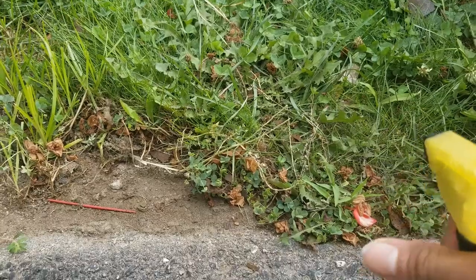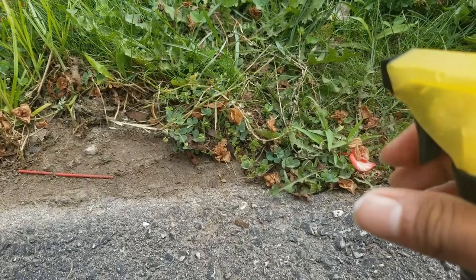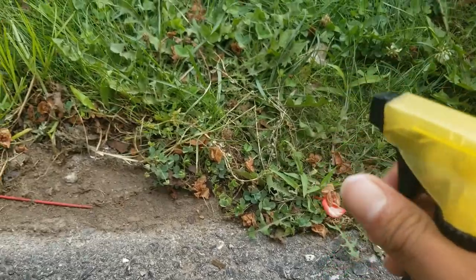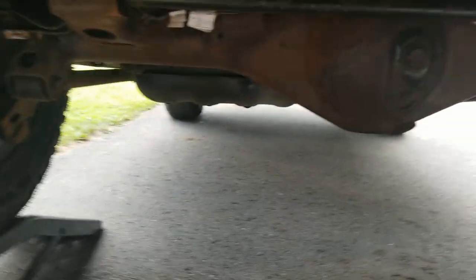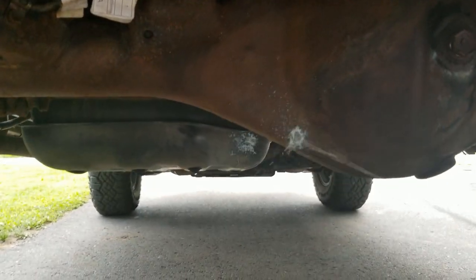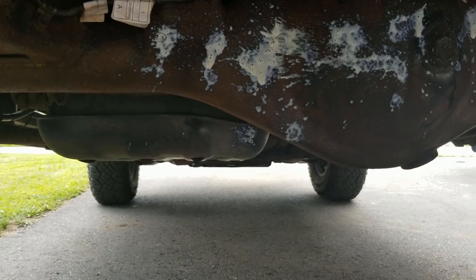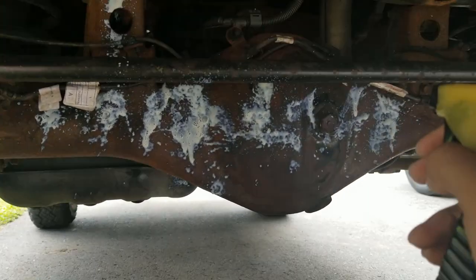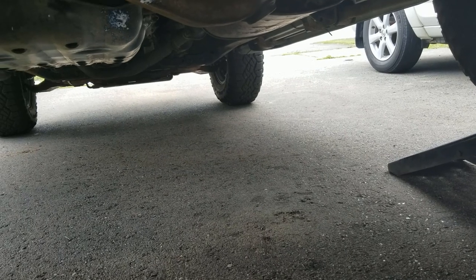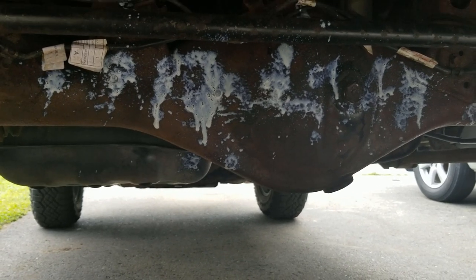I thought it might be just a water-type liquid, but it is a white, creamy type substance. What it does is trigger a chemical reaction on the rust and convert it into a paintable surface. That's why I didn't take too much effort to remove all the rust — I knew this product would convert whatever rust was left to a paintable surface, kill it, and turn it black. If you buy this product and get a spray can, just make sure it sprays properly. When I sprayed mine it wasn't great, so I used a paintbrush — I sprayed a portion at a time and then used the paintbrush to apply it everywhere.